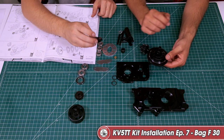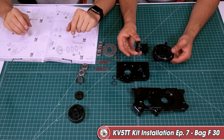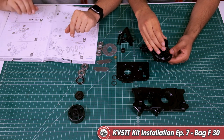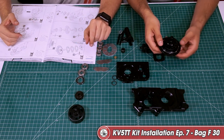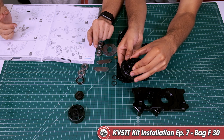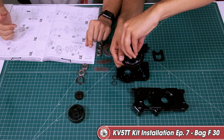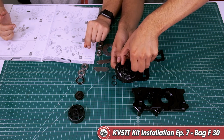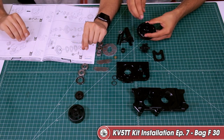Next, you're going to put your adjusting nut on — you're going to want to put this end down. We put just a little bit of blue Loctite down in the threads of the nut and we're going to slide that in place. You're going to have to try to keep the disc springs from moving around while you get the adjuster nut seated and threaded down. You'll notice the adjusting nut will bind if the disc springs are out of place, so just keep working the nut down little by little, adjusting the springs to make sure they're level and even.